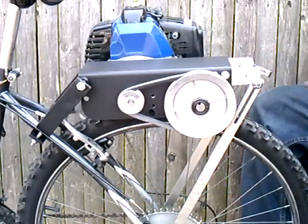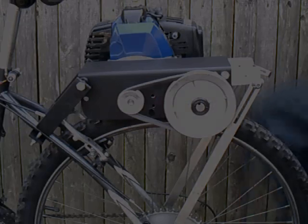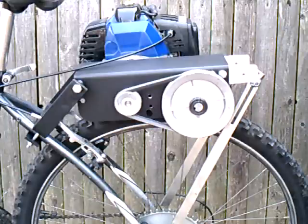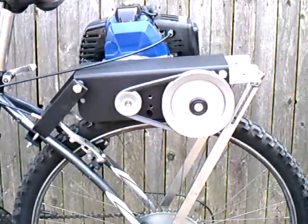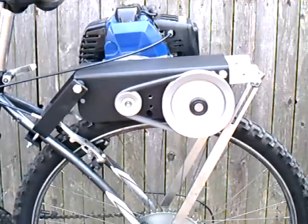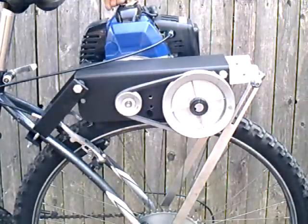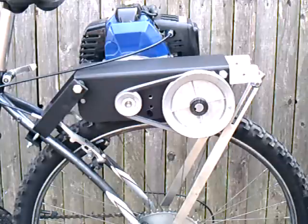I'm going to go ahead and start the bike before we actually install the chain — get things rotating, make sure there's no noise and everything looks proper. I'm going to start up the engine and rev that up to make sure everything's rotating properly. It's going to sound a little bit loud — this is a 52cc Harbor Freight engine, two cycle. The camera mic is really close to the engine so it's going to be a little bit loud. Everything is rotating properly, but you really can't tell if the belt is going to slip until you have load on there, so go ahead and put that rear chain on and give it another test.